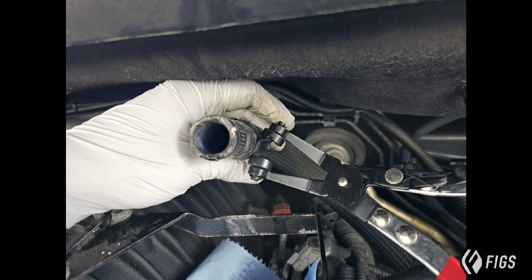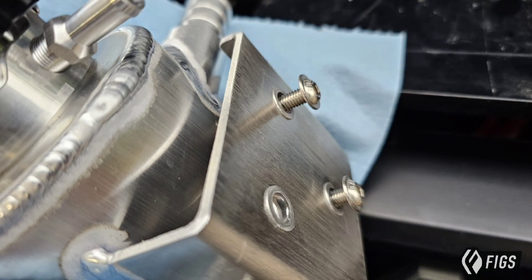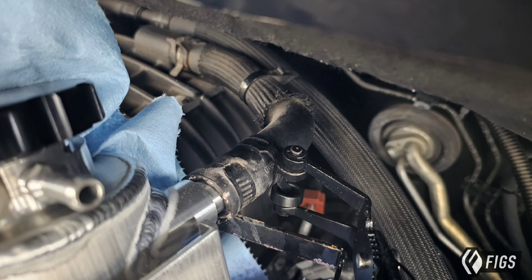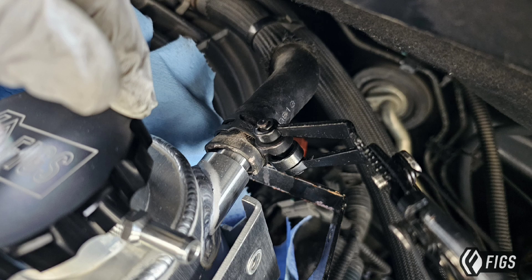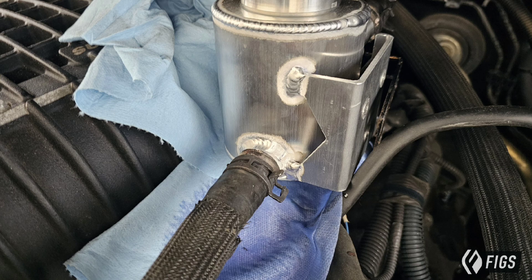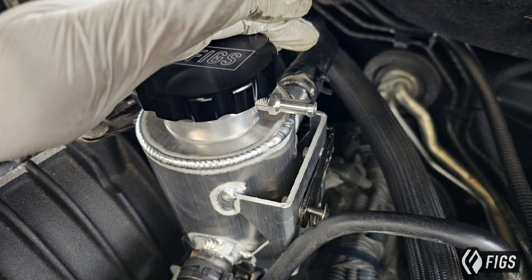Use your spring clamp tool to squeeze the constant tension clamp and put it on that tube about three inches down, then start the installation of the fabricated tank. Slide it down that tube so you can get the barb installed, then pull that clamp back over the barb. That barb is going to provide a much more positive seal than the previous nipple on the blow-molded tank. Be patient with the clamps. As you lower it down on the other side, you may spill a little coolant, so throw some shop towels underneath to catch anything you might miss.